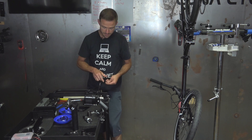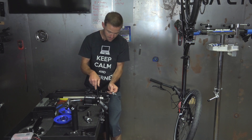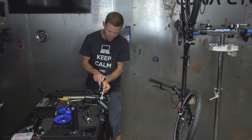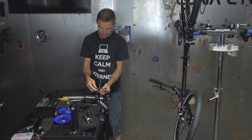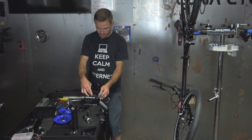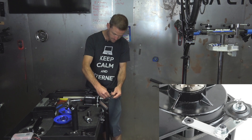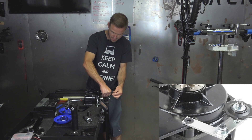On the other side, you're going to take your tensioner, which has a taper, and put your flathead screw through there. Through the upper hole on the bracket, put your spacer on, and then feed it into the motor. We're just going to snug this down.